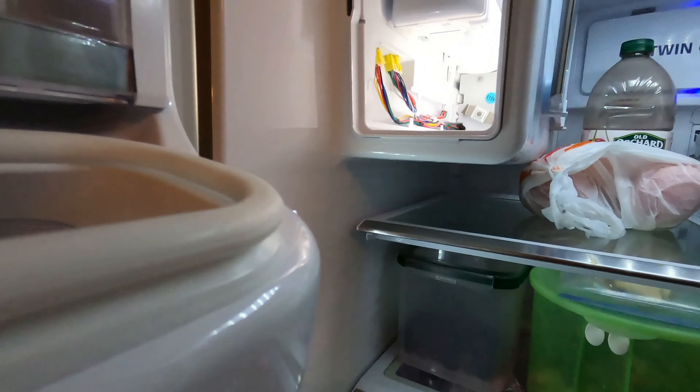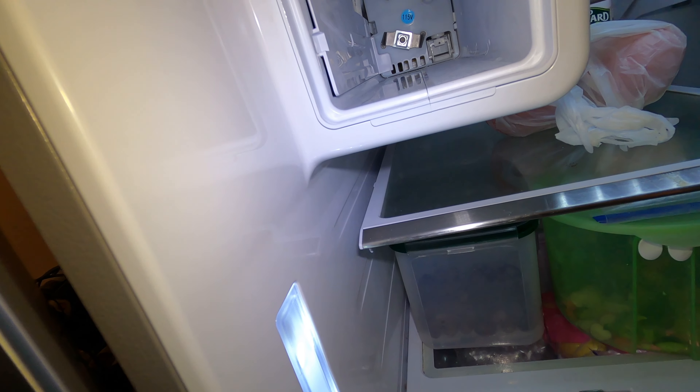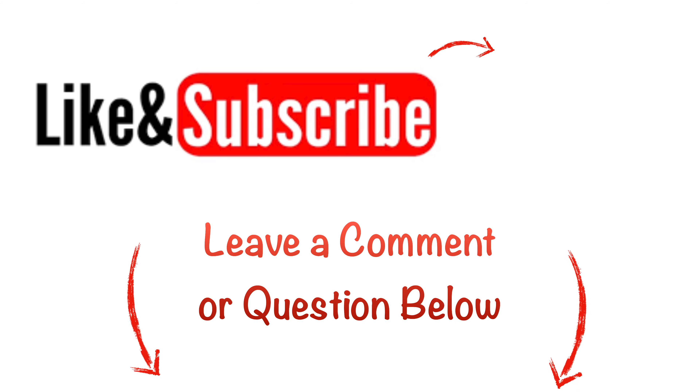This ice maker cycled and filled up with water — it didn't do that beforehand, so it was 100% the ice maker. I don't really have any other diagnostics other than trying the ice maker; I never really had any issues with anything else whenever it comes to ice maker issues on this. Just make sure you put everything back together like it's supposed to be. Give it about four to six hours or so for it to drop ice — that's usually how long it takes, sometimes about 24 hours depending on if the fridge has been running or not. So if this helps anybody, give me a like, subscribe, and I do appreciate y'all watching.